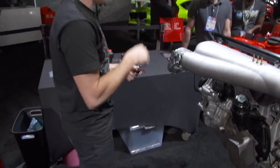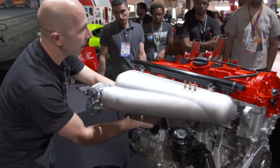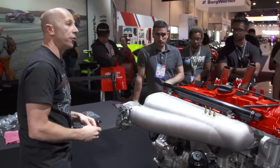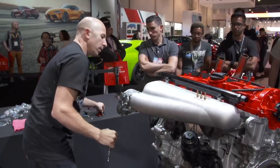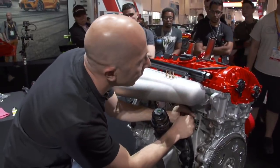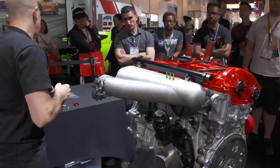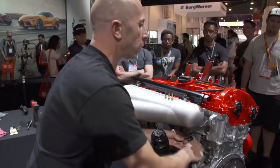Because the engine control system knows which cylinder is firing at what time, if it hears knock during that timing, it knows that it's from a specific cylinder. That's what's cool about the modern ECUs, is they can actually tell you which cylinder is knocking. And typically on these inline 6 engines, numbers 5 and 6 will be the most susceptible to knock, because they're typically the last to get cooled, so they typically run a little bit hotter.